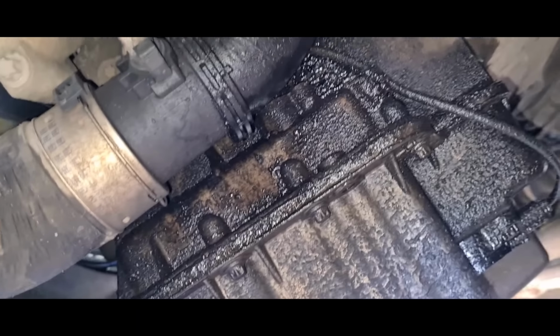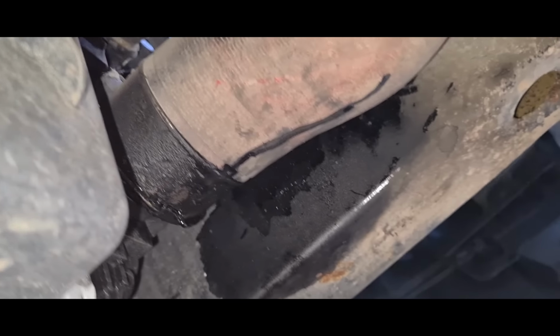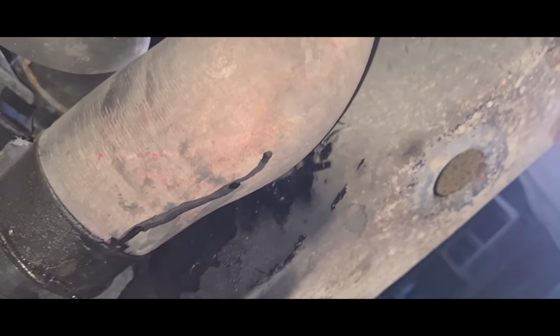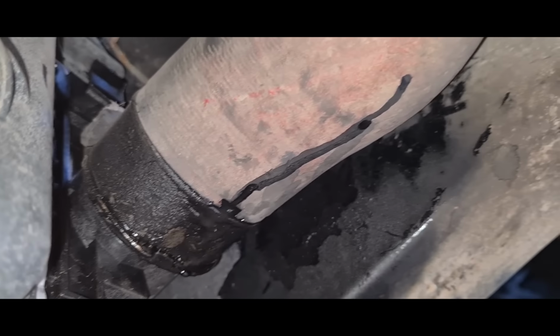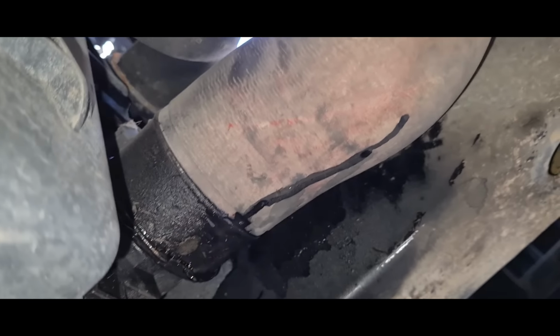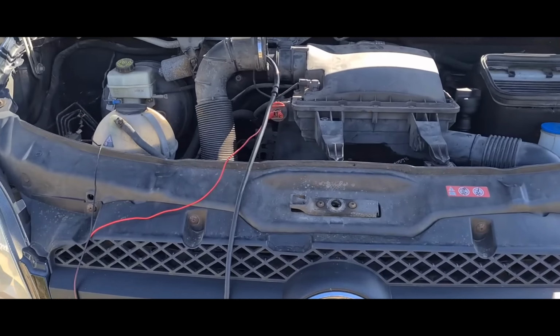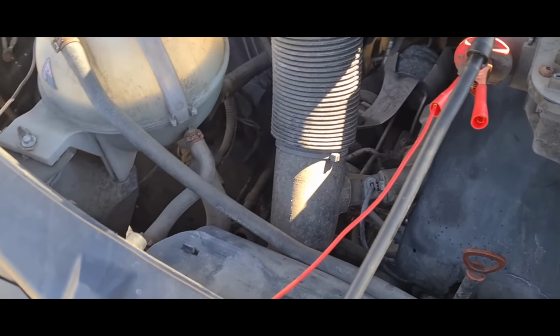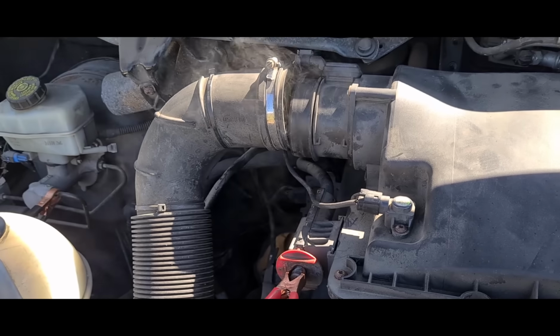You can see we've got a big oil leak here from the engine block somewhere. Well, I don't have smoke over here yet, but this area looks suspicious because we have wet, oily residue around the chassis there and the pipe. Okay, so a few minutes have passed. We have no leaks found. So, question is, what's going on? So we disconnect the smoke test.